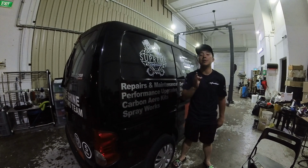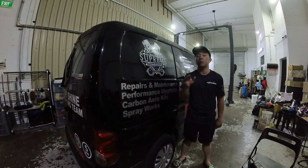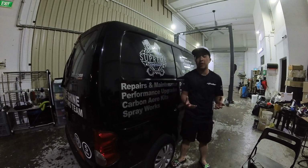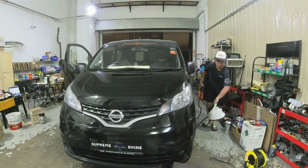Number 3, when using the steam cleaner after letting it rest for some time, when you spray the steam cleaner, sometimes water will come out. This water is hot and you should be very careful with it. Spray it away on the floor, away from people, and never point the steam cleaner at anyone, including yourself. Lastly, because you're dealing with a steam cleaner that contains very hot water, remove any tripping hazards or anything that might prevent you from moving around carefreely when you're using the steam cleaner.